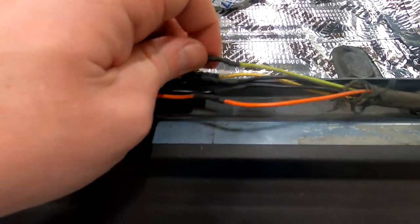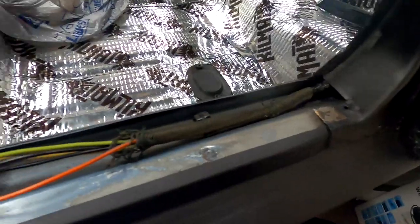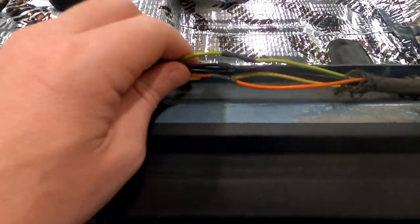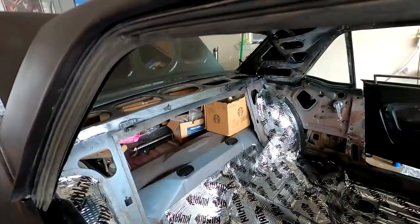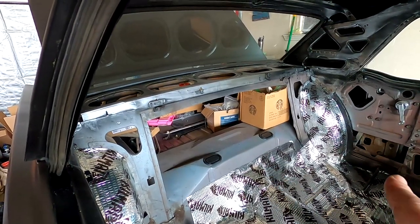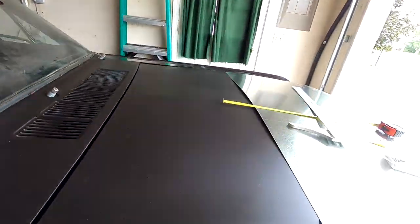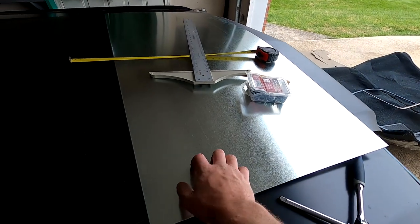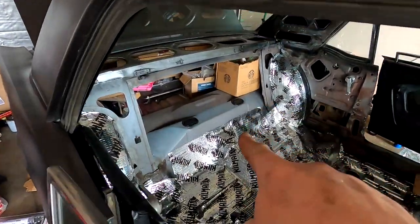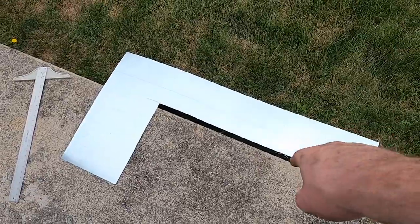I managed to get the wiring harness cut, fed through the trunk, back along the quarter panel, into here, and everything soldered back together and sealed up. This section I'll just wrap real good with electrical tape and we can move on. I need to put a divider in the back seat here. You can get a steel one online for about 66 bucks plus shipping, but I just went to Lowe's and picked up a sheet metal for about 28 bucks. I'm going to cut a section out and seal off the back, then throw whatever kill mat I have left on it.